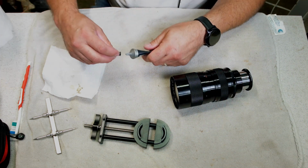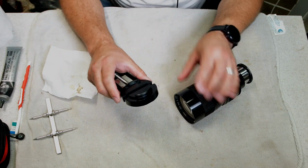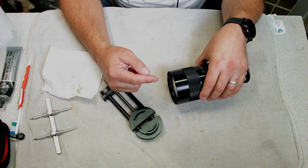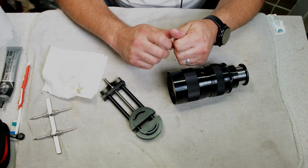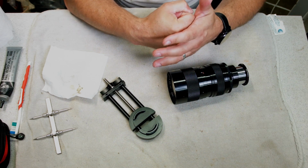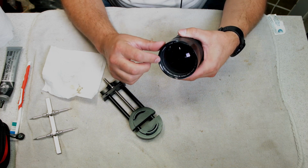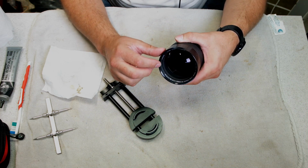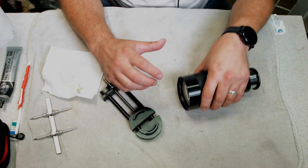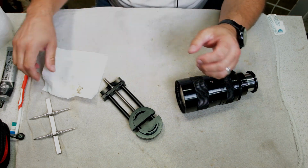What it does is, on the tool, when you're putting the thread repair tool on there, if it's dry and clean, as you're trying to straighten the threads, it can bind in there and start rubbing, and you can actually rub the anodizing off, or tear a thread or cross thread. So what the grease does is it allows it to slip just a little bit to kind of massage that metal.